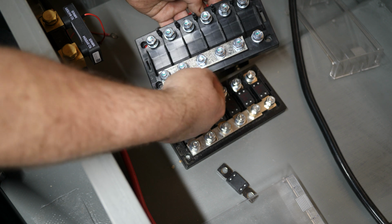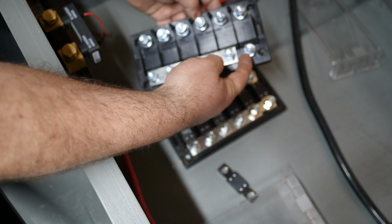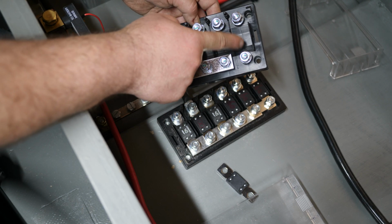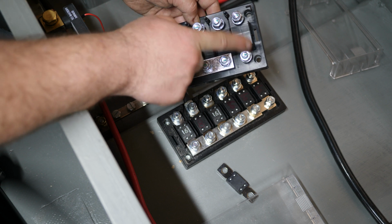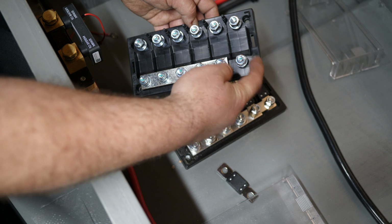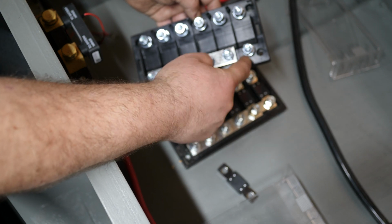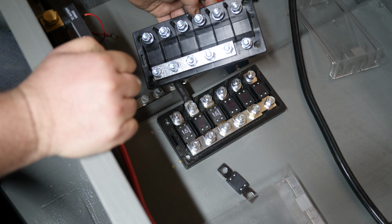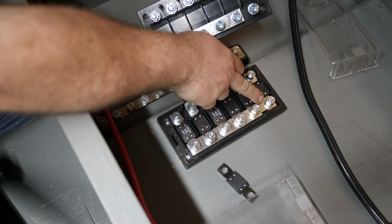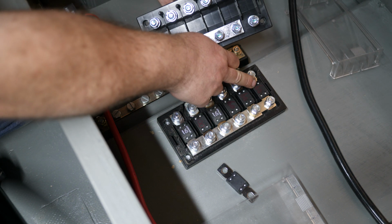And you see a bus bar here that connects 5 terminals, and you have one terminal free, so you can use this, for example, for something else or for a different voltage in your system. But I would prefer if this bus bar was just 6 and that there was a line here where it says cut it here if you want to have this separate. But for 35 euros you can't complain, so I just made an extra bus bar that connects the 6th fuse to my system.